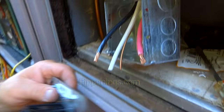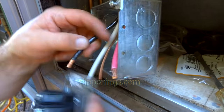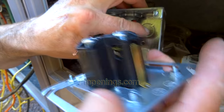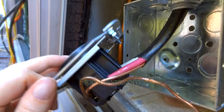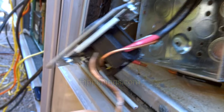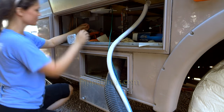Let's put these in first. Once you get the 50-amp receptacle all hooked up, you've got to make sure to leave a little piece sticking out so that you can ground the box. And now to mount the J-box.